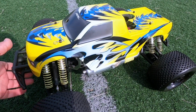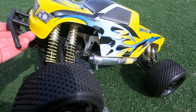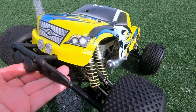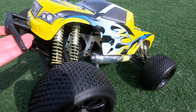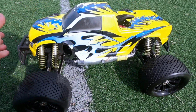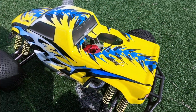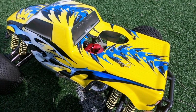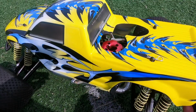We got a tragedy, guys. I think we have blown our engine. Now, I just put the camera on top of the car and I was trying to do some speed runs, but I was giving it throttle all the way with the same consistent tune that I had before, and it just wasn't moving. It wasn't hitting those high RPMs. So off camera, I came back, I leaned out the high speed needle. Guess what? Almost no results as well.